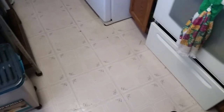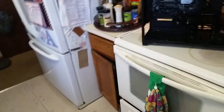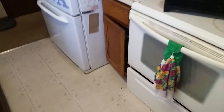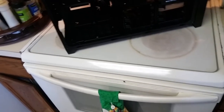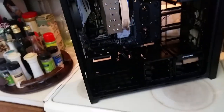Hey guys, it's Cranky B. I actually got my kitchen all torn apart today just because I'm starting to build a PC here. I'm using my phone to record this mainly because I haven't made videos in so long all my camera batteries are dead and I'm not even sure where the chargers are. I'm doing it on top of the stove in the kitchen because it's a flat surface and it's right near the sink, which I can touch to ground myself of any static charge to avoid damaging any of these components. Some people think that's overkill and it may be, but I don't want to ruin anything, and when you can take such a simple precaution like that I don't see why you wouldn't.